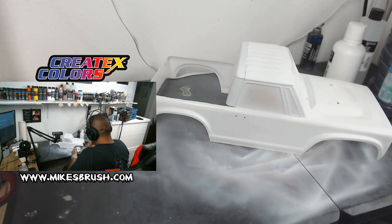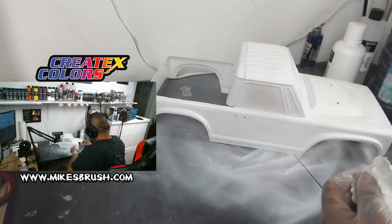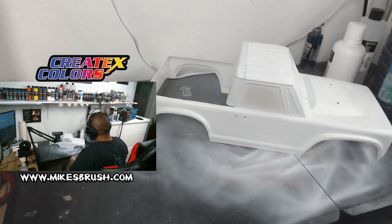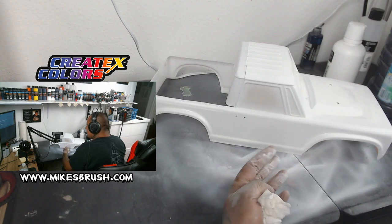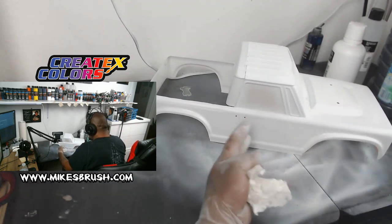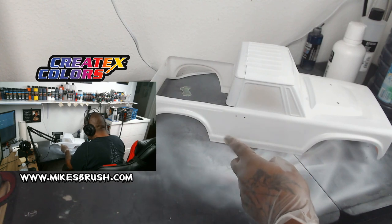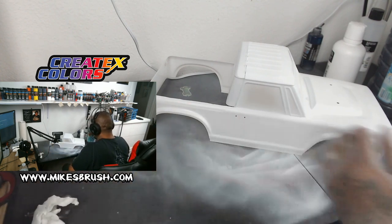Lexan from the inside or the outside is going to end up being about the same. It's really super duper smooth. The thing about the inside is that you don't ever have to worry about it getting scratched or damaged because all the damage happened on the outside. On something like this, it's a little different. So you want to make sure you get max adhesion, because if somebody nicks it, you don't want a whole bunch of paint to flake off. You know?